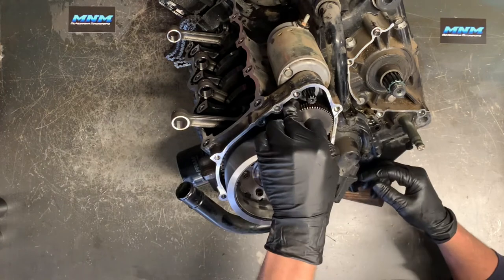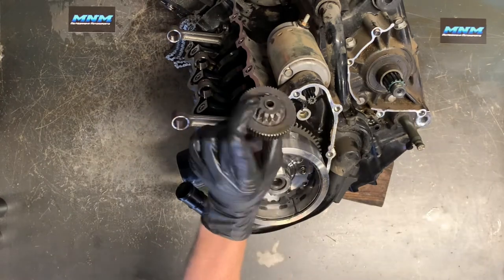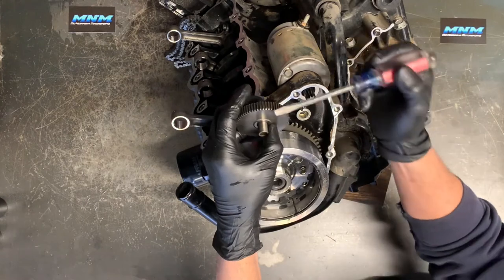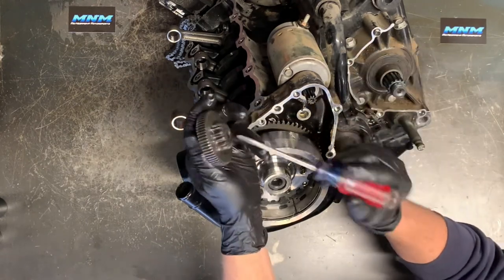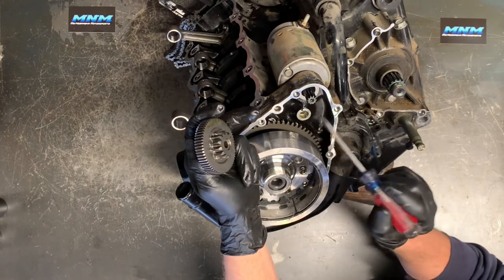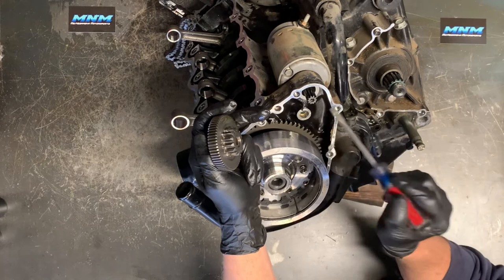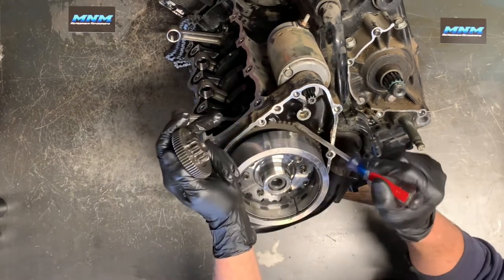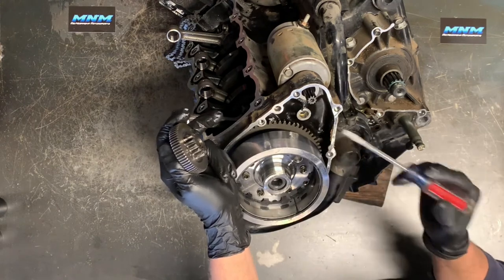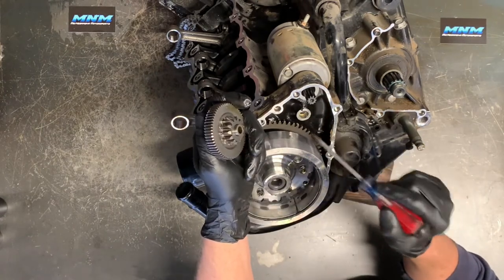Make sure you comment below so you could possibly win that flywheel puller — I'll announce the winner on one of my YouTube videos. This right here is a starter drive, also called a limiter gear or starter gear. The gears on the starter motor turn these smaller, finer-toothed gears, which turn the larger-toothed starter drive gear behind the flywheel. It has a one-way bearing — I'll show you that when I pull the flywheel off. This gear should only turn one direction; the other direction is what turns your motor over when you hit the starter.